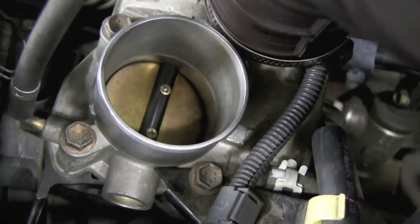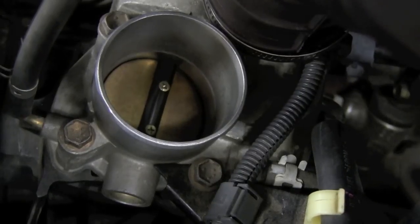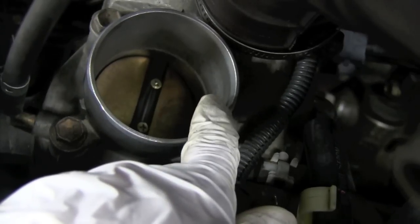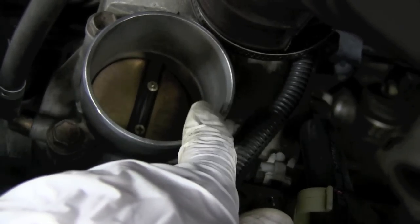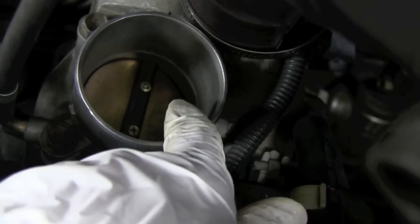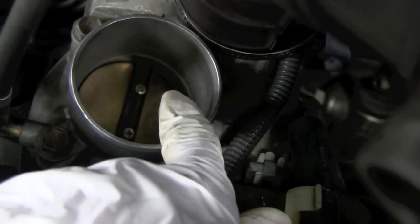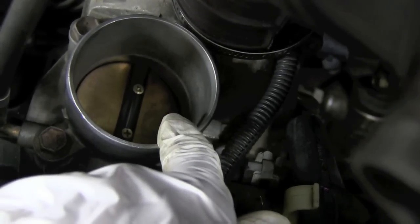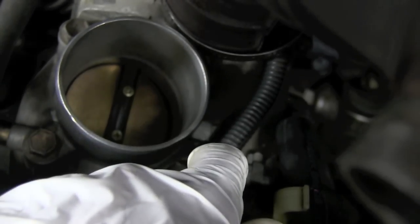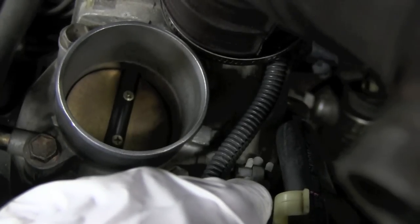We can also have air leaking out of an intake valve, just like it could be leaking out of an exhaust valve. What you would do is open up the throttle body plate by having someone depress the accelerator pedal and listen for any air coming out. If there's air coming out of there, it's leaking out of the combustion chamber, through the intake manifold, and out of the throttle body — meaning you have a problem with the intake valve, either burnt or bent, or anything else preventing the air from sealing, potentially even a bad valve seat.